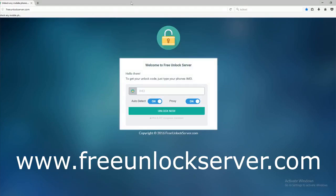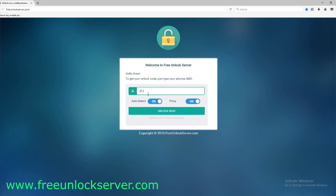Now we will switch to the computer. On this website, we will request the unlock code to unlock our Samsung Galaxy phone. We're going to start by filling in the information of the phone we want to unlock — this works for any Samsung Galaxy model. Then, most importantly, enter your 15-digit IMEI number. Double check it and make sure it is 100% correct, because if there's a mistake, this method will not work. Then proceed by clicking Unlock Now.